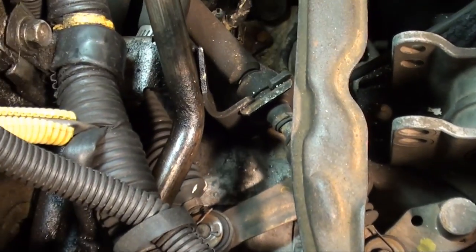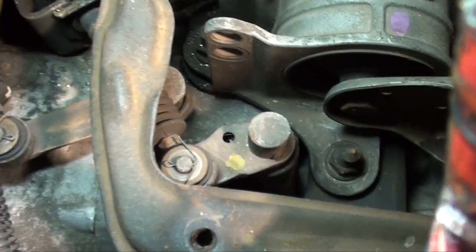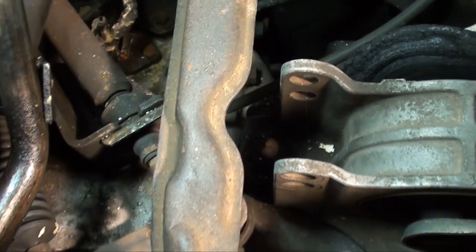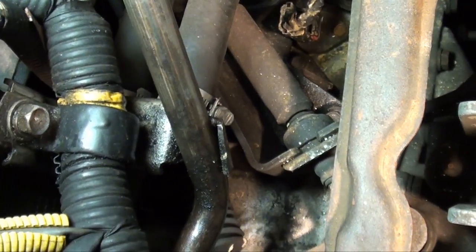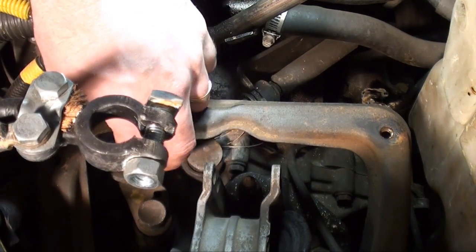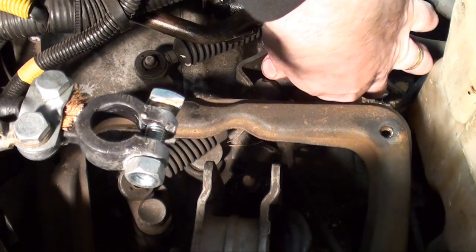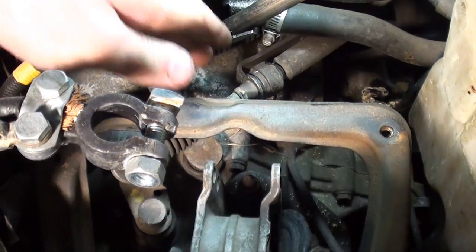come down here and we're going to remove the shifting cables next, the shifter cables. As you can see, there's just a cotter pin. Remove that cotter pin, lift it up off. That clip simply pries up and out, and you have two cables. Do the same for both of them. Just like so. Got the cotter pin out. Nice and easy. Japanese.